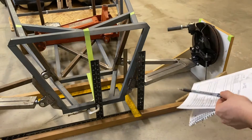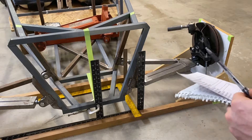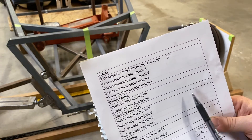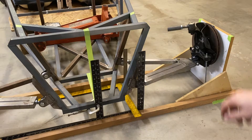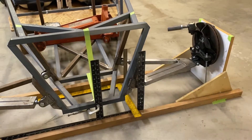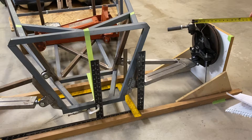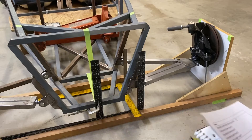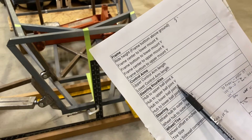That gives the X distance. For the upper mount, we don't know that one - that's what we're trying to find out. Lower control arm length can be found in a similar way with just another square on this side. Hub to upper ball joint X is hub face to the upper ball joint location. Since I have the hub bolted into the jig, I can just measure to the center of the ball joint from the inside of the jig face, which is the same as the hub face.